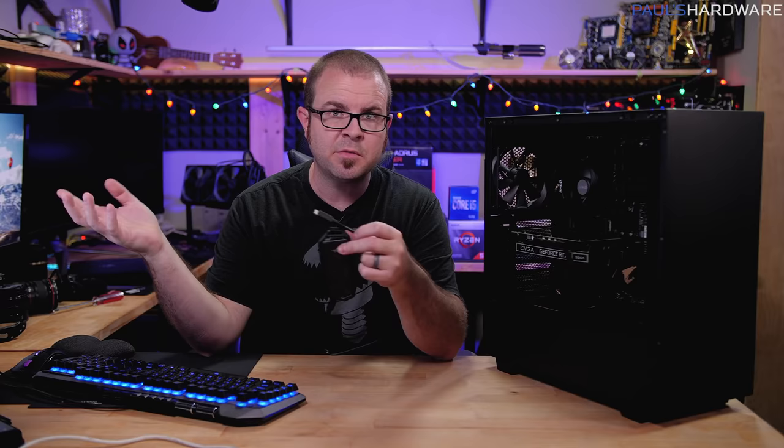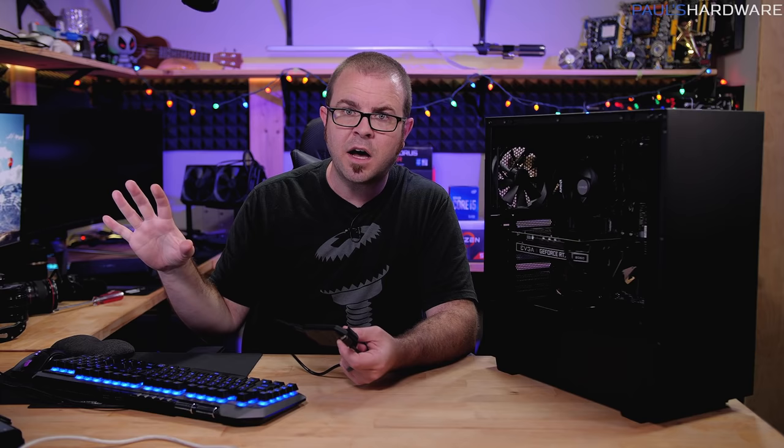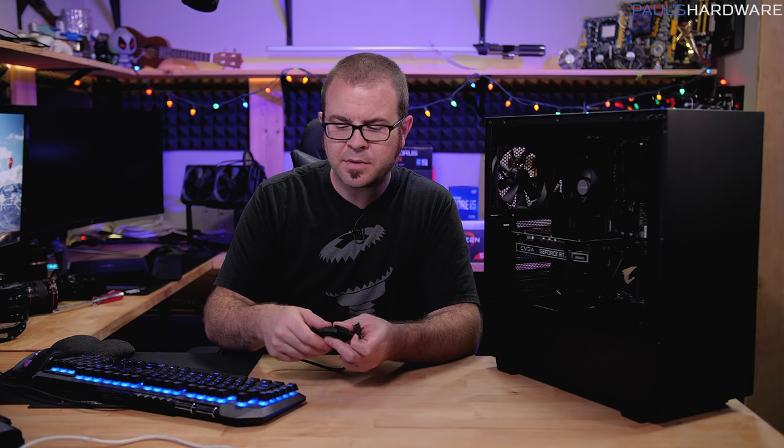I'm doing a few things a little out of order — I'm trying to do everything on the secondary computer that needs to be done before we move on to the new system. So now I'm going to plug in my mass storage device and do a little bit of backing up. If you're upgrading from an old system, you want to make sure you have everything off of it that you might need to save. It helps to back up your My Documents folder, get a list of all the applications you have installed, and make sure you have your own filing system for important data — especially irreplaceable stuff like pictures. Just make sure all that stuff is backed up, ideally to multiple drives.